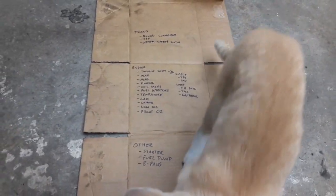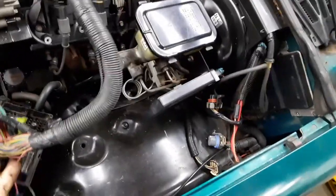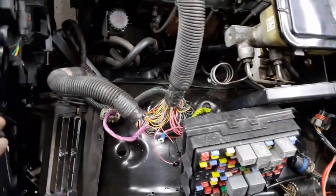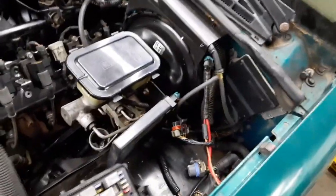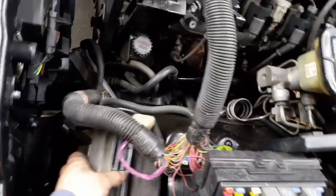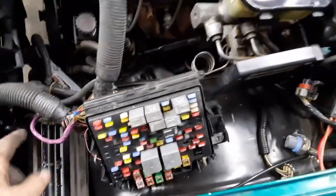On the Silverados, Tahoes, and similar trucks, the fuse block is located on the driver's side right above the wheel well. Conveniently on the S10 there's nothing over here, so I'm going to mount it basically the same way and run the whole harness the same way — no worries about wire lengths or re-looming. The fuse block is going to go somewhere over here for now, and the computer is going in a nice convenient space close to the stock location on a Silverado.